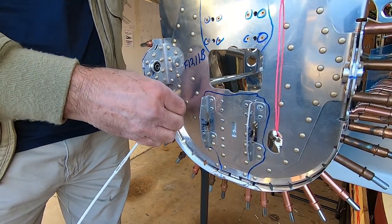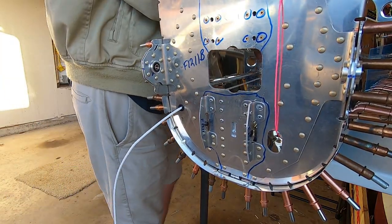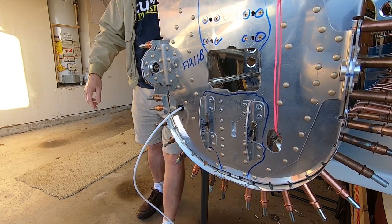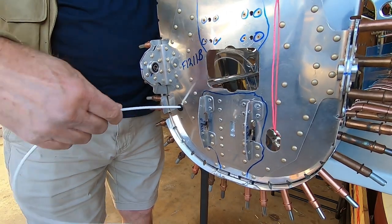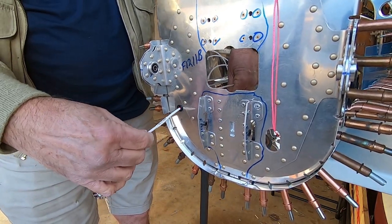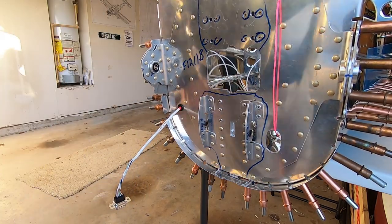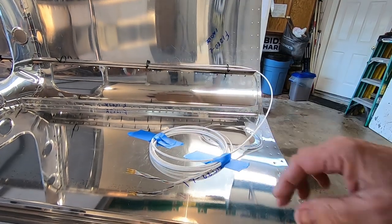Now for the trim control wire. This wire will lay inside the J stiffener hook on the side sheet. The cable is then zip tied into pre-drilled holes in the skin. The red tape on the wire lines up with a snap bushing. Just like the string, the cable is coiled up inside and taped down.